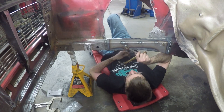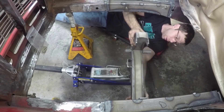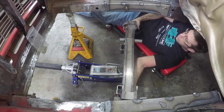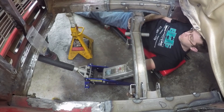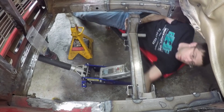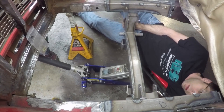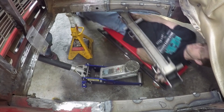Now bolt in the guide plate on the most forward bolt hole — this provides a guide to line up the crossmember. Those guide plates need to be perfectly 90 degrees with the frame. The crossmember is made intentionally just a little bit too large because a lot of these frames had flexed over the years, so they give you extra working room. When it goes in, don't be surprised if it's too large — that's fine, that's expected. You need to guide it and trim it down.